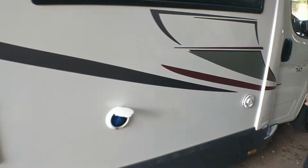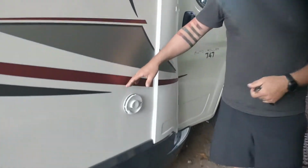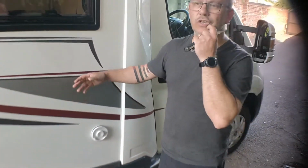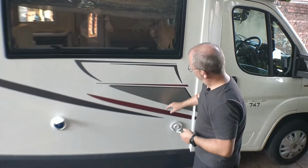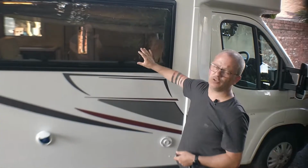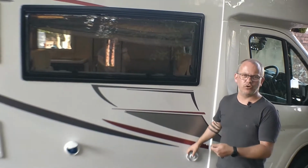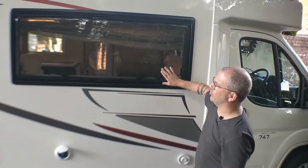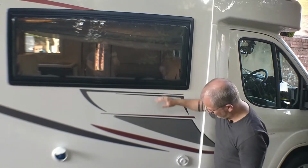Right. On this van, you'll also notice on all vans we have these. This is the flue for the heating. Now, same as your house, the fumes coming out of it are not good if breathed in. So, with this window, they all have a safety switch. If you leave this window open, your heating won't work. So, before you call us, if your heating's not working and you've got no hot water, please make sure that the window nearest the flue for the heating is closed.